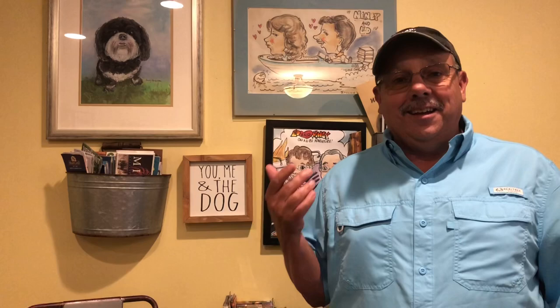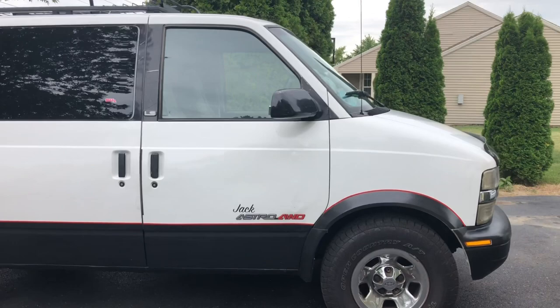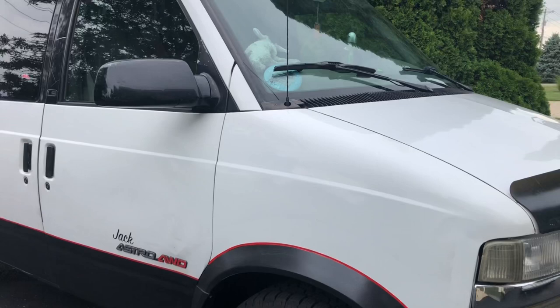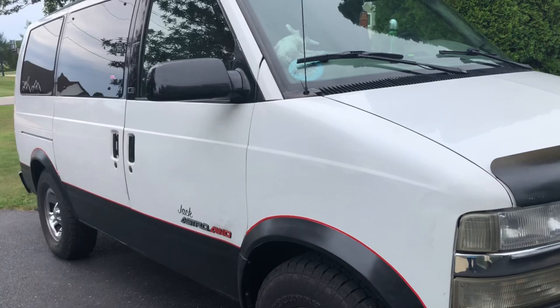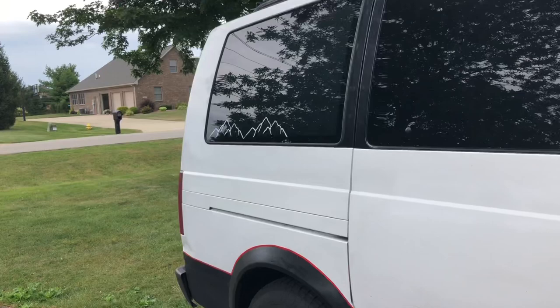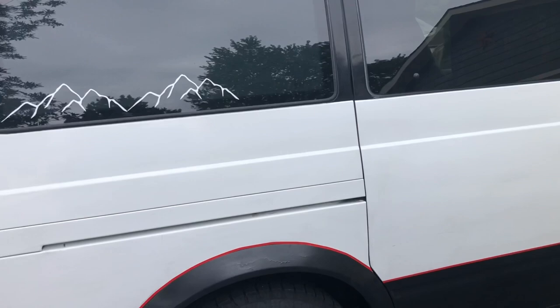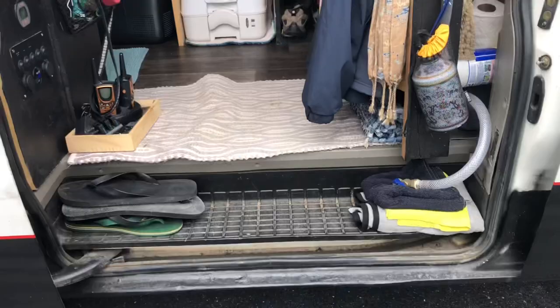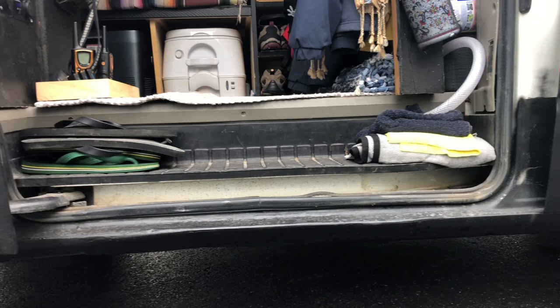Because things didn't turn out the way I wanted as far as the videoing goes, I thought I'd run out here and show you what the finished product looks like. I went ahead and put this bed liner material around the wheel wells and on the lower half — it's got a rough texture just like a bed liner on a truck, and it turned out really well. Because the line between the black and the white was not crisp enough, I went ahead and got some red pin striping and put that on there, and I think it really set it off nice. I also wanted to show you this doorstep that was all rotted out — I welded in a new rocker panel and fiberglassed over the top of it just to smooth it out and make it look good. I am really pleased with the way it turned out.